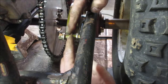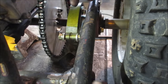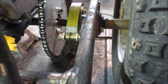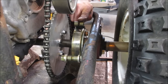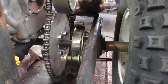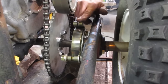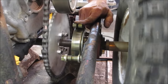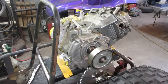So I have to flip it around so that the bottom half is in here, and we're going to pull on the cable up here. So I'm going to flip that around. Hopefully it does not get in the way of the clutch setup that's up here. But trial and error. There we go, flipped over. I like that better because you're going to get a better cable pull. Does it make sense now? It's helping pull the band around it, where the other direction, if we're going this way, it's fighting against us. It's trying to push the band off of there and you can't get as much pressure. Whereas this way, much more drag, this way slips. Perfect. That's a little time to set up.